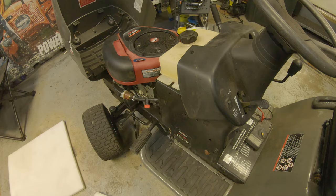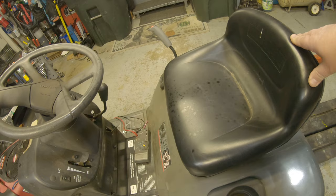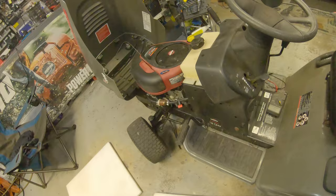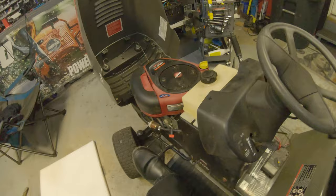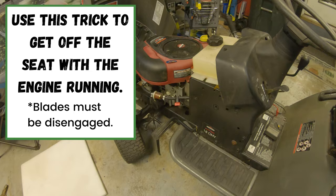I got that brake safety switch in place now. I'm holding the seat down so it doesn't beep while I'm talking. Let me show you this real quick — then I've got one more safety switch on this mower to show you. There's a total of four, plus your key switch and your solenoid on the carburetor. Let go of the seat — push that brake pedal down. That shuts off the buzzer. A lot of people don't realize this: you can lock this brake pedal down. Hold that brake pedal down and pull that rod right there up — that's your parking brake to hold that pedal down, so the brake is engaged.